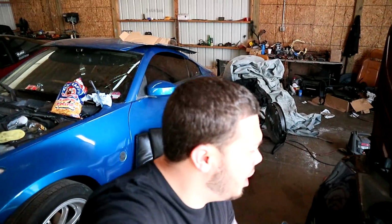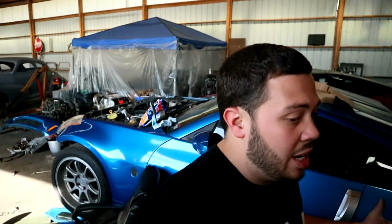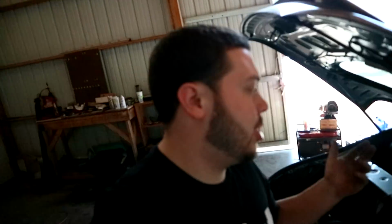What's going on, guys? Well, Travis is out skating, and I am out here trying to figure out why exactly my car is cranking slow. I think I already did. Chris basically came in here and said, hey, the wire you're using for your ground or for your starter power is way too small, which is understandable because it was literally just a cut-up extension cord. Not extension cord, cut-up jumper cable.